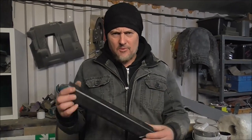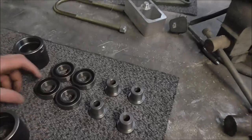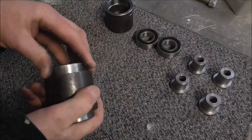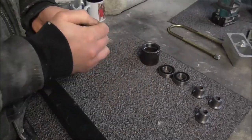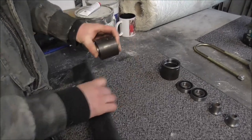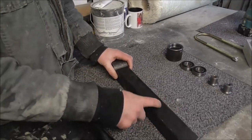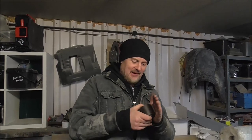For the rear arm, anything that pivots has got to have a pivot point. To replace the rear bushes on the back of the arm, engineering legend Dave Lathe has made these parts. We have these bearings that fit in there, and these bits that go in and meet in the middle, and then that bolts into a mount on the chassis giving us lovely smooth articulation in the rear of the car. We just need to weld this heavy gauge box to there, bolt it back under the axle with the U-bolts, attach the airbags, and that's it — job done. They really are so nice. With hot rod legend Lee Cox and engineering legend Dave Lathe, it feels like I actually have a team — I don't feel quite as alone anymore.